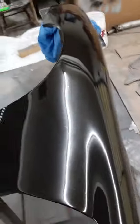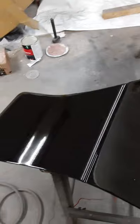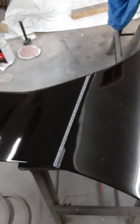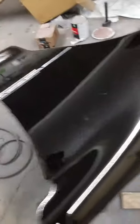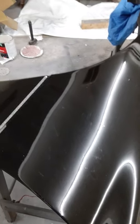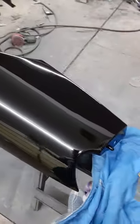For the most part this stuff looks pretty good. It's like the Euro stuff. I used some of their primer on other projects, but I didn't even prime this because it's a brand new fender — it's plastic. I personally don't think it needs to be primed, because what am I sealing off? It's brand new and there are no imperfections in it, so it would have just been a waste of time to prime it.